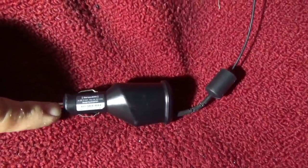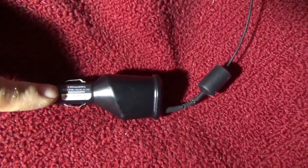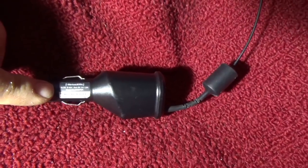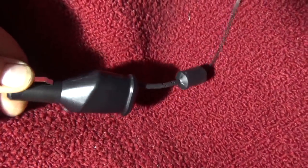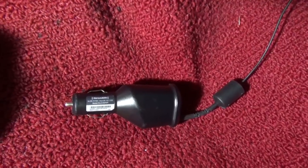This is the reason I want to install the outlet — this is the plug for the Sirius XM power supply. It says on here: input DC 9 to 16 volts, output DC 5 volts. You can see by looking at this it's pretty complex, and I don't want to cut this up and ruin it. That's why we're going to install the plug for this underneath the dash.